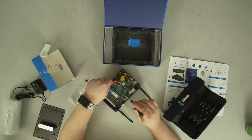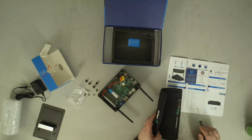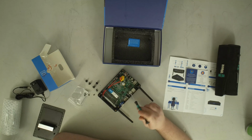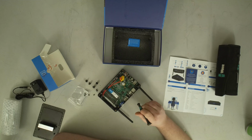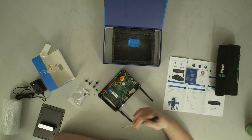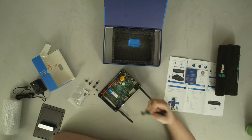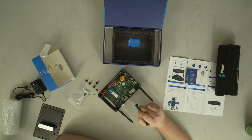We have this M.2 slot, which is for an NVMe drive, I believe. And yeah, so this is an NVMe. Now, this is only an M.2 x2. It's been a long time since we actually saw an M.2 x2 SSD, so you're not going to find one that's actually designed for that typically. But some of the drives that we say don't quite hit the interface limits, or have performance issues due to things like host memory buffer, or they use QLC memory, aren't going to be as big of an issue if you're only on a 2x2 interface.